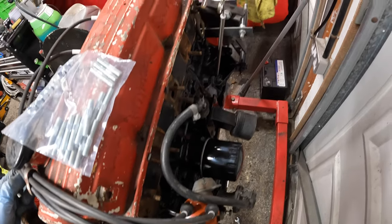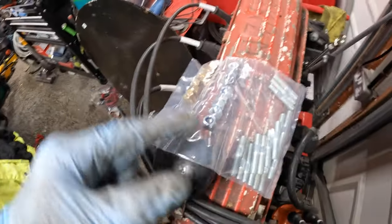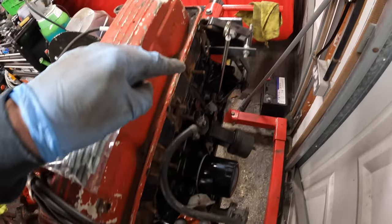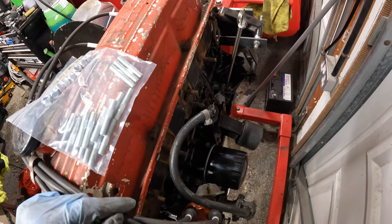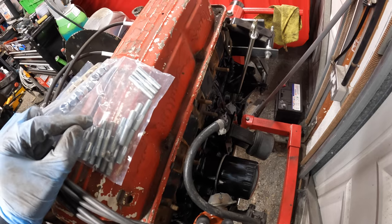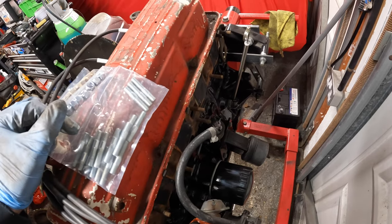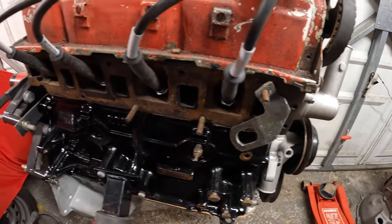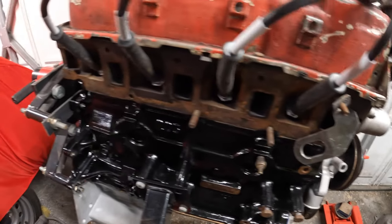Things are starting to take shape and I've just found my new studs. I'm going to go around and replace all of the old studs — some are left in from when I removed the inlet manifold, some came out with it. On the exhaust side there are literally only a couple that stayed in, so I'll remove all of them and fit all the new ones.